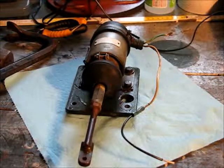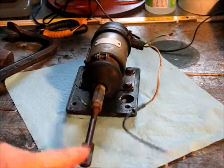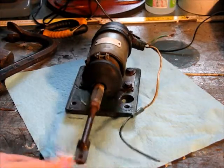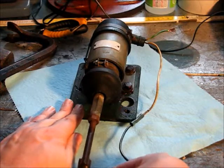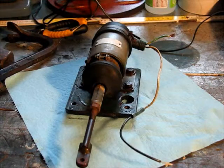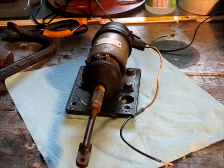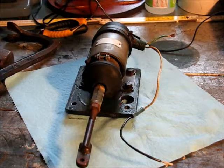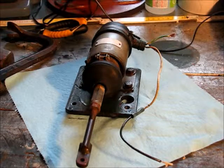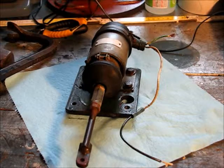There's a few other pieces that I took off that are actually quite interesting to see. This basically yanks up the start and stop, or the engine cut lever, when it is actuated. Probably was put in there as a safety. It was all in series almost with an oil pressure switch and a temperature switch as well. So I think this was added as a safety.